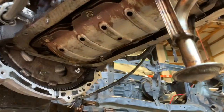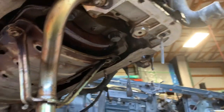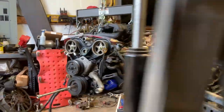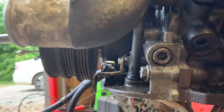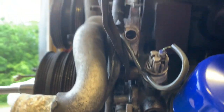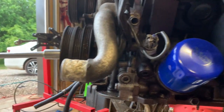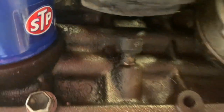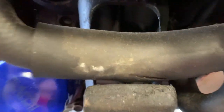We're going to be undoing all the 10mm bolts running along the oil pan. Now that we got the oil pan off, you can see we're going to have to take the guard off and drop the oil pan pickup tube. Once we got those two out of there, we are also going to have to make some adjustments to the dipstick tube. As you can see, this is a front mount - so it goes right in the front, right behind the radiator tube in the bottom.